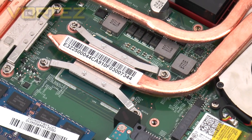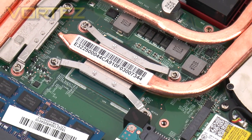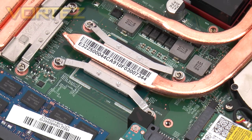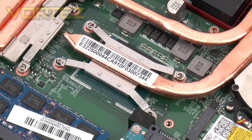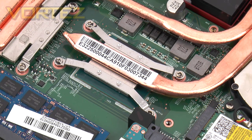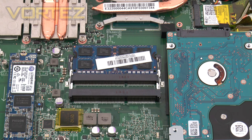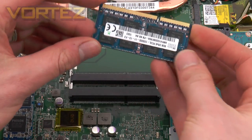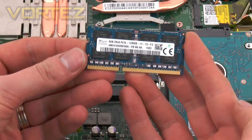At the very heart of our notebook is Intel's Core i7-4720HQ. This processor is relatively new to the market, having arrived at the start of the year. It's quad-core, based on Haswell architecture, with a base speed of 2.6 GHz turboing up to 3.6 GHz. The notebook has two DDR3 slots allowing up to 16 GB of memory. MSI has supplied the GE72 with 8 GB of Hynix 1600 MHz DDR3, which should be sufficient for most enthusiasts and gamers.